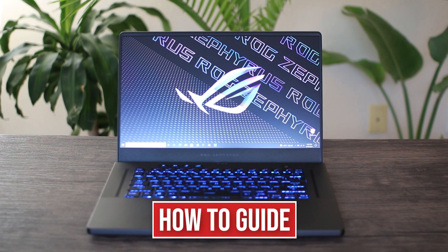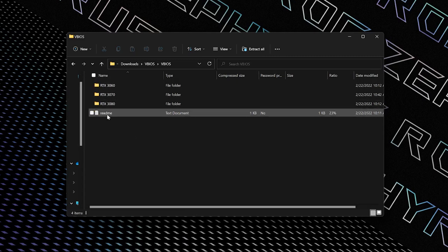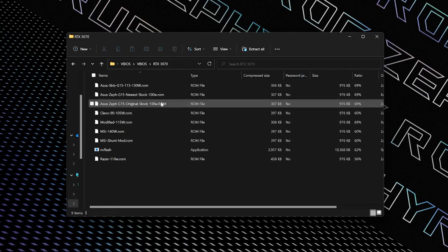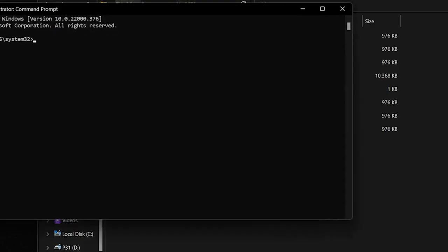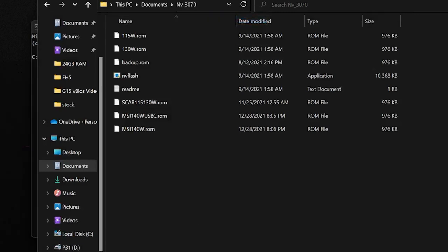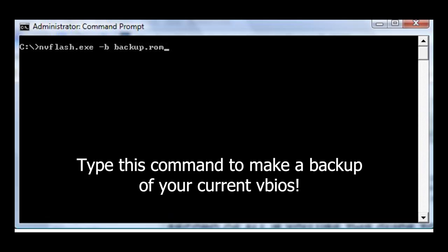So let's load up NVFlash. I've got a link in the description for downloading it. It's a zip folder that contains the program itself as well as my selection of a lot of community-tested VBIOS ROMs that you can try out, but I'll also have each link separately in the description. Once you've downloaded it, you're going to want to run command prompt as admin, find the location of the folder where the VBIOS is saved, unzip it, copy the address text, and then in command prompt just type CD, lowercase space, and then paste the address text. It should look like this. Now that you're in the folder in command prompt, you need to first make a backup of your current ROM. You can flash back to this backup in case anything goes wrong with whatever VBIOS you're trying to use.